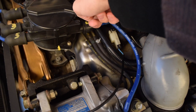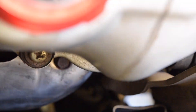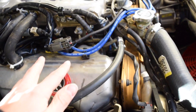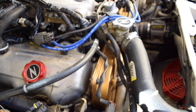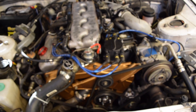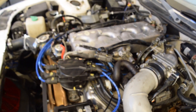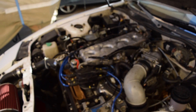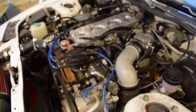The first thing we're going to do is remove the plug that's right there. There's a little fan down here on the side — it's that little duct right there, an injector fan that mounted on this bracket. If yours had that, there's going to be a sensor on that side you'll need to unplug and undo. If you didn't have one of these injector fans, basically all you had on that side was just a plug in that hole. Because I have the fan, we're going to undo this plug. I snipped the wire because I didn't have an oxygen sensor wrench — it is three-quarter inch, so you should be able to find something with a groove in the side if you don't want to cut it.